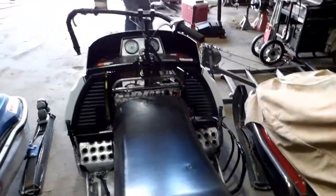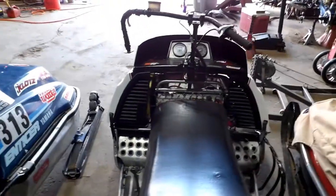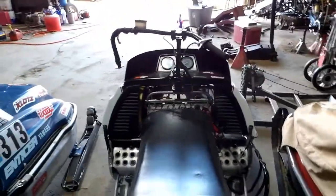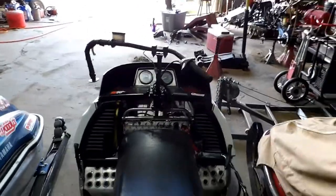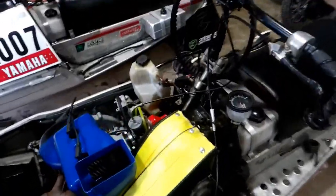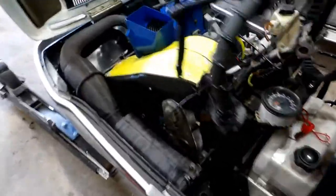The chain case stuff — we just took apart the left side where the speedometer drive would be. There's a big 27mm nut, and then a housing. We just took the sprockets off the chain case and left the case on the unit, which was nice, then slid the drive axle out. Everything's basically sitting in front in the hood area on the exciter. I'm also getting intel on putting a hydraulic brake setup on one of these. If it's going to be too much work we'll just go with the cable brakes again for another year. My motor is still in — everything should be good engine-wise. I'm going to cut a new chain to length for the chain case and do a little video on that.